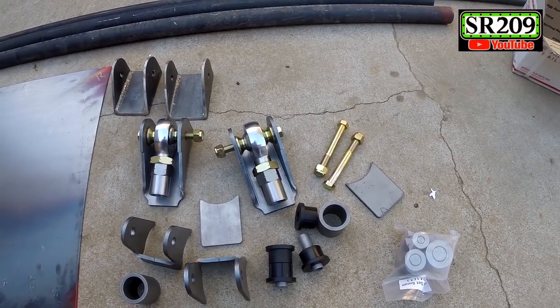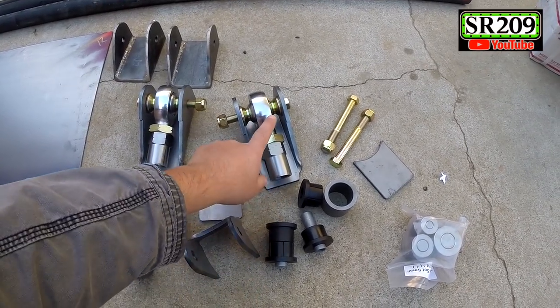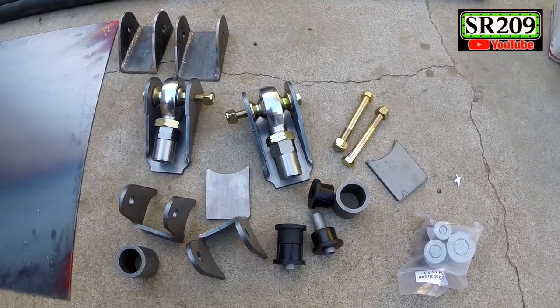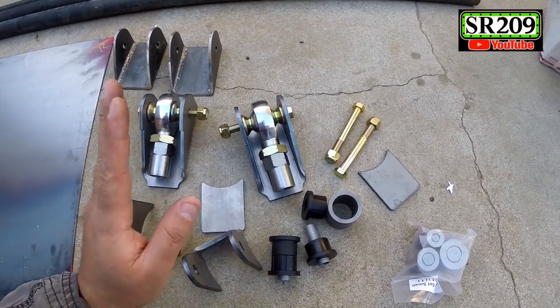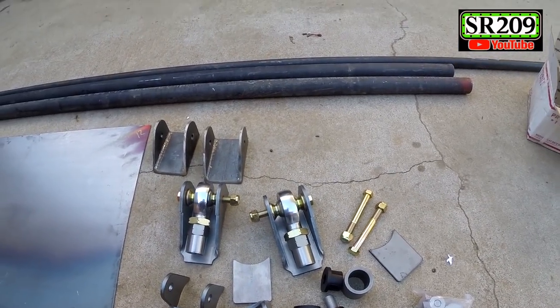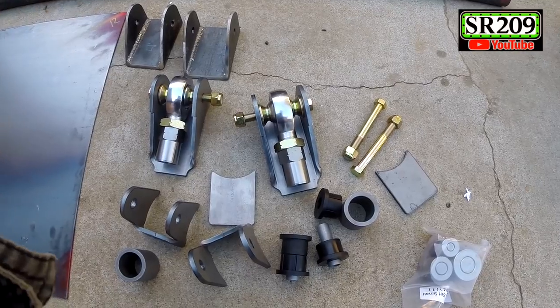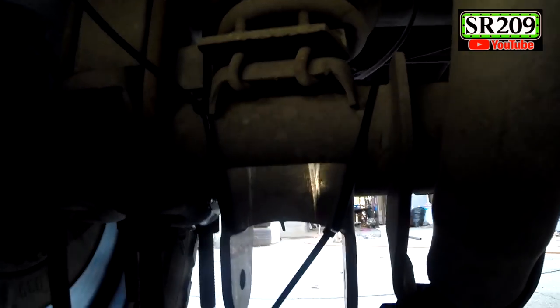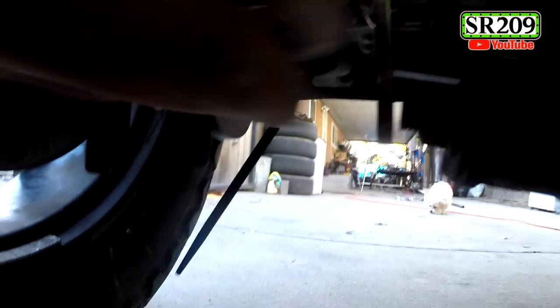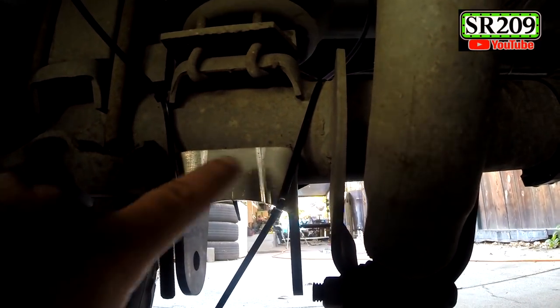First thing I'm going to do is tape this up against my axle — possibly clamp or tape the bracket. I want to get as close to a perfect measurement as possible for where I need to cut that bar. I want it slightly under because I have a little bit of adjustment. I just used some zip ties so you guys can see and to hold this up — gives me a good idea of where I want it welded. That's a good spot right there, right in the middle of both brackets. I'm going to leave that and move on to the front one.